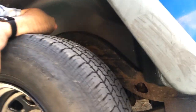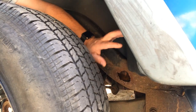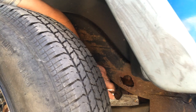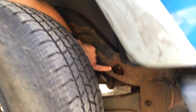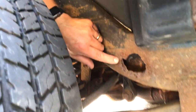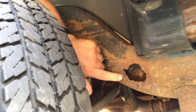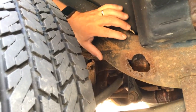Hopefully it's a quick repair. You can see it right there - basically there's supposed to be a hole in the frame here, just a vent hole where air can flow through, but you can see it's rusting away and it's a lot bigger than it's supposed to be. It won't pass a sticker. The frame is still fairly solid around it but this area here is bigger than it needs to be.